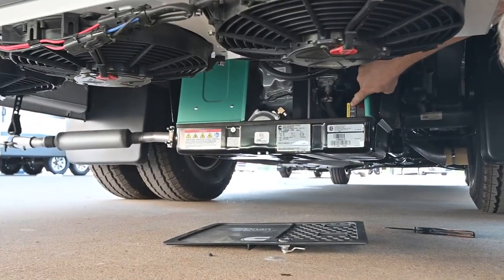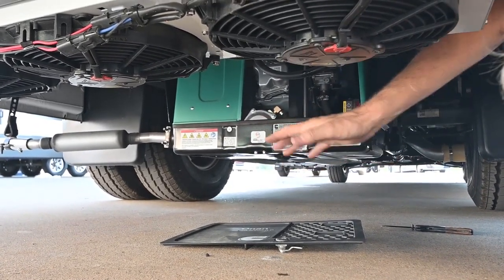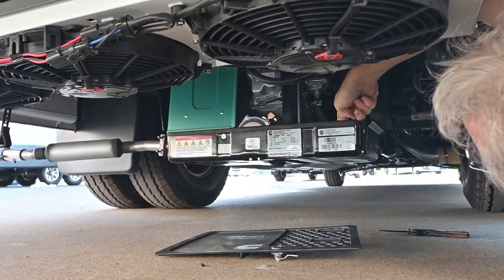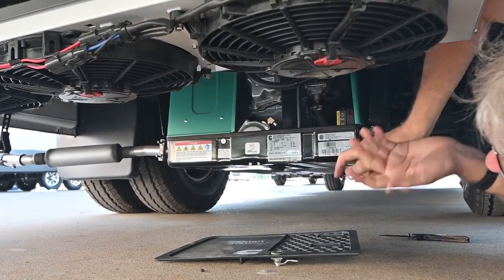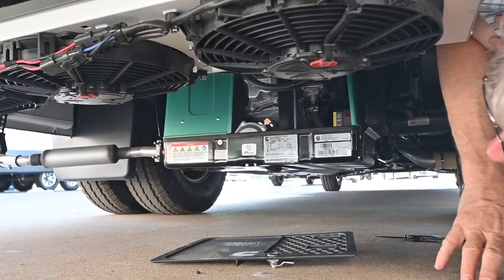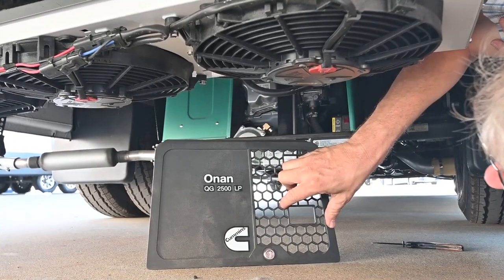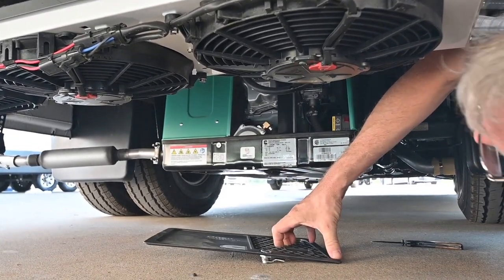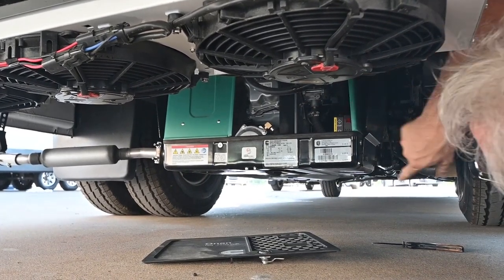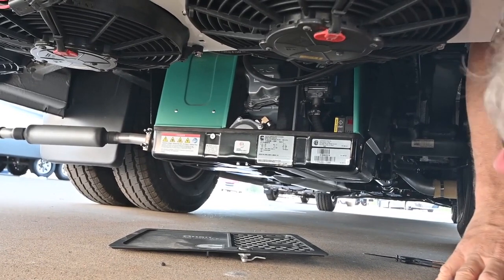There's also a breaker in here - it says circuit breaker. If this circuit breaker on the generator trips, I won't have any power switched to the inside of the coach. Reach down here and pull up on it to reset the generator breaker and you're back in business. Hopefully that never happens, but if you overload it - say you turn on the air conditioning, the microwave, and it's charging the batteries hard - it could possibly trip. Just know where the breaker is and how to reset it. There's also a start and stop button here, as well as the air cleaner - you'll also change that out when you change the oil during service.